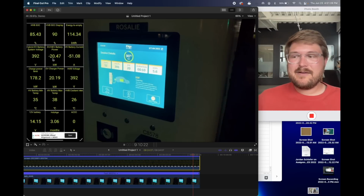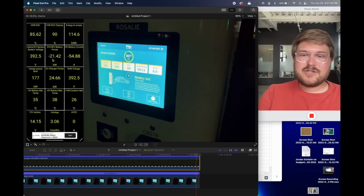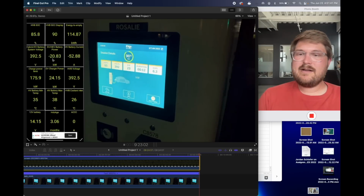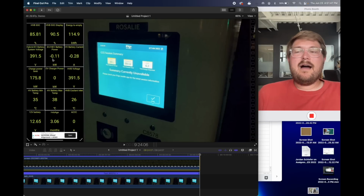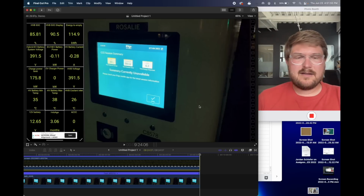You're going to be wasting your life, and you're really going to be blocking the chargers, which is going to become a bigger issue. So here we go, 1 hour, 12 minutes from 0 to 90%, 1 hour, 12 minutes of straight charging, and there's your curve, 0 to 90%. That's the session, and I'll pause that. It already paused itself right there. Not terrible. So it's about an hour, let's just say plus or minus, to go from 0 to 90, a little bit less, a little bit more than that.